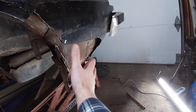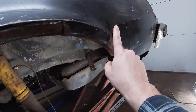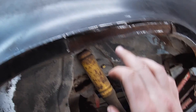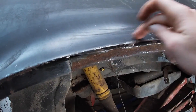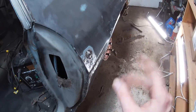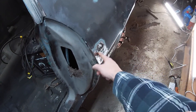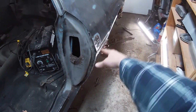We'll replace that, and replace this side panel over here. Everything's looking good. Up in here, we'll probably do some type of rust encapsulator — I think they sell some stuff on a hose you can stick way up in there and coat this whole thing to make it really rust resistant and make sure all the rust is encapsulated up inside the panel. I didn't want to get into this body line here, because whenever I come back with the replacement, we'll have to go higher so when we cut it, we can make it super nice and seamless. So what we are going to do really quick is actually get some primer on this just so it doesn't rust, because if I leave it much longer — it is in a garage, but if there's any humidity, this will rust up from where we pulled out those dents as well as welding. So before we put body filler on it, we're going to primer it up, make sure it doesn't rust.